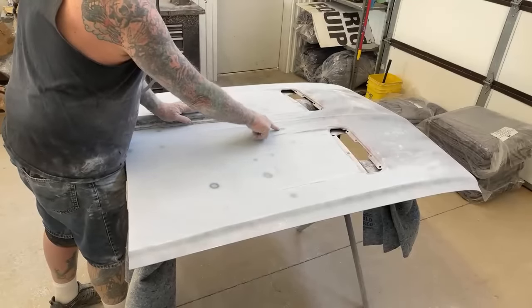Okay, we're back over at the hood. We've got to have this hood looking awesome - we want to win some trophies, go to the car show and get first place. That's what my friend Pete wants: a first-place show car winner. We got the hood in the picture. Now we got our bondo, and it's very important that you add some plastic honey to it. It gives it extra gripping power. The reason we're using 36 grit is because it leaves very coarse action where you sanded, and the bondo will get inside those cracks and crevices and grip really strong.